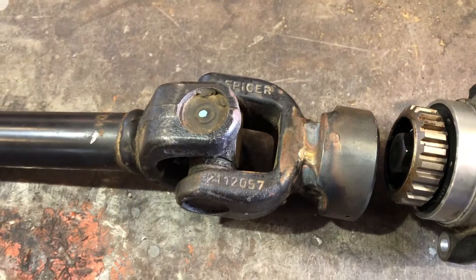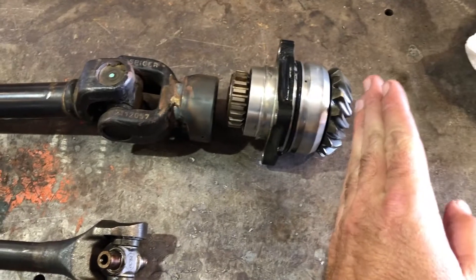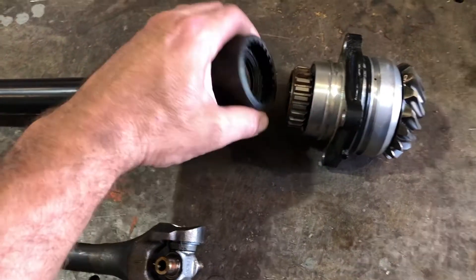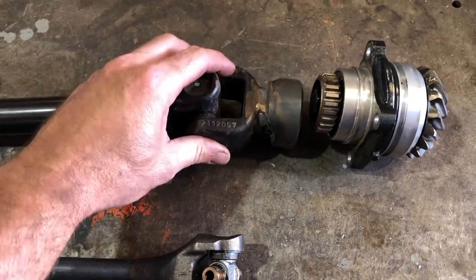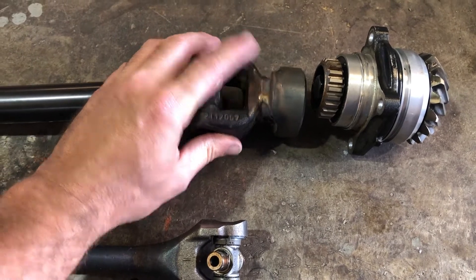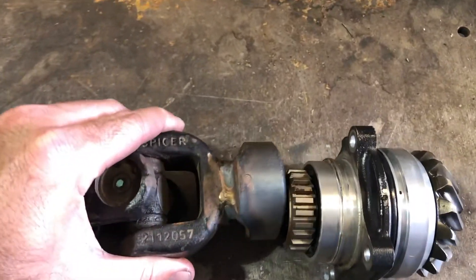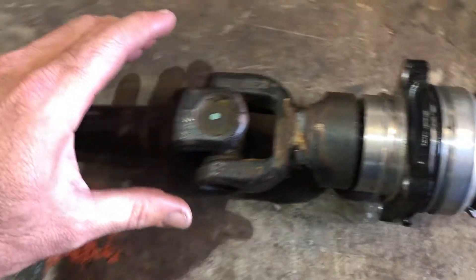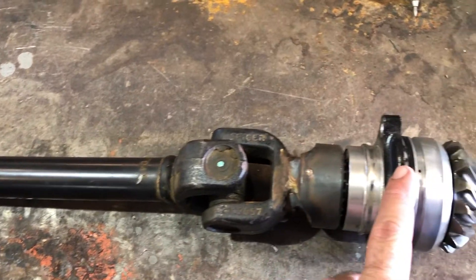Look what we have here. That is a Kawasaki output shaft — this would go to the back of the motor right here, and this would be the back of the case. This is the Kawasaki factory U-joint. Cut the tabs off right here, machined this to fit in it, drilled it and put a dowel pin — hardened steel — and then TIG welded this thing completely solid. So now I have the snap ring or the retainer out. It'll be just like that.